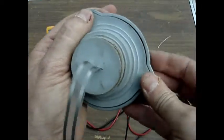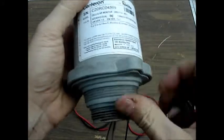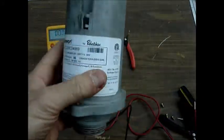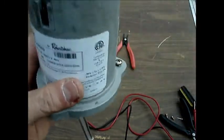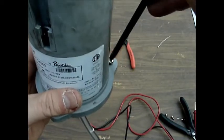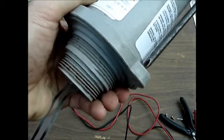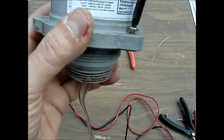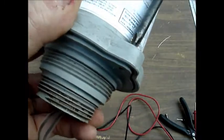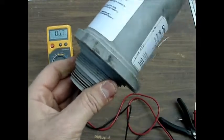Once they're lined up, carefully press, alternating from one side to another to make it go in even. You'll know if it's in properly because it'll get almost all the way in, all the way around. Return the screws to their proper holes and retighten them tightly enough so that they suck that little excess in on the bottom, but only finger tight. They don't have to be very tight. Just make sure that they're taking that last 1/16 of an inch of that base position up as you tighten them. See how that just kind of sucks that right up there. That's what you want to do for all three.